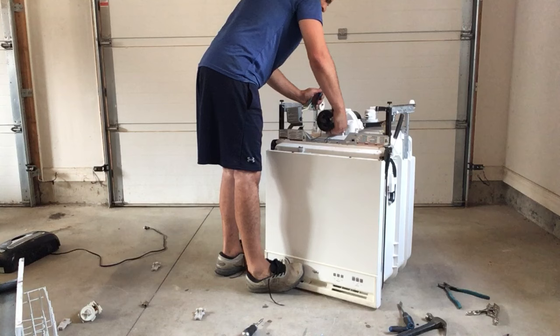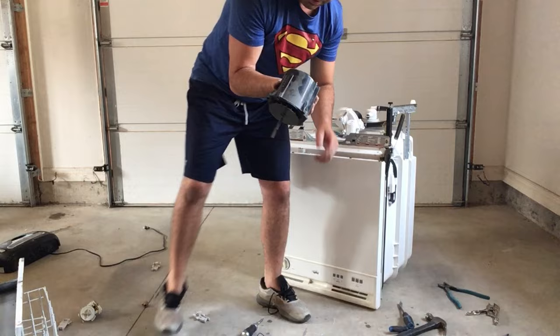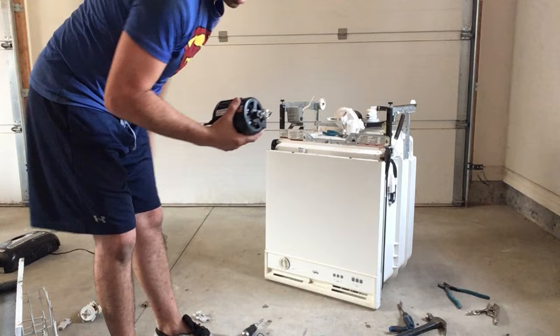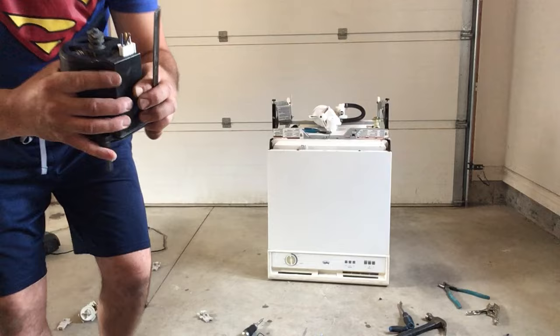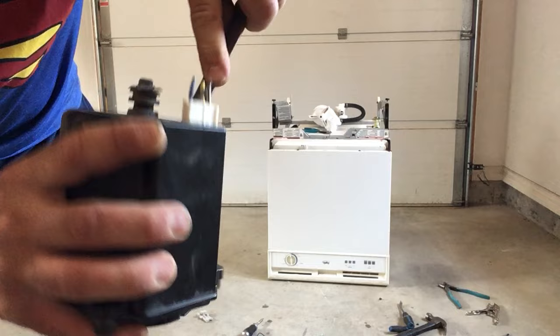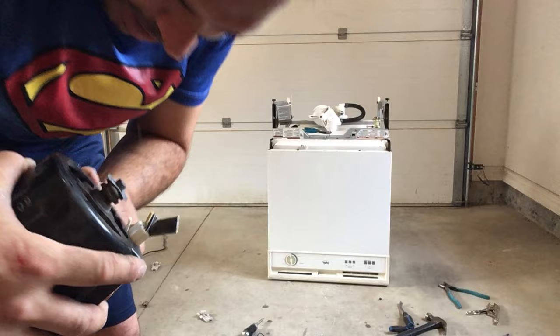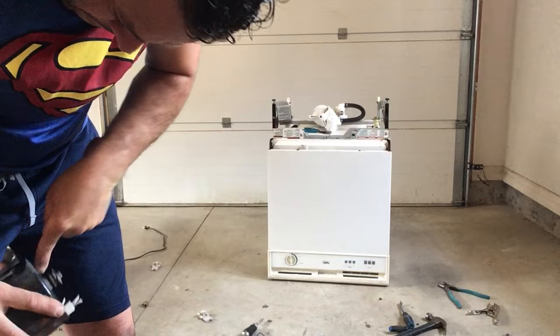There's some really nice brass here. The motor — see if I can pop it off. There is a clamp holding it in. Now, moment of truth. I'm going to take a file and scratch the winding pieces. If it reveals a metallic look underneath, then it's aluminum and I'd just throw it into my motors pile. If it reveals a copper look, then I am going to take the time to remove that copper because that is going to give me number two copper price.